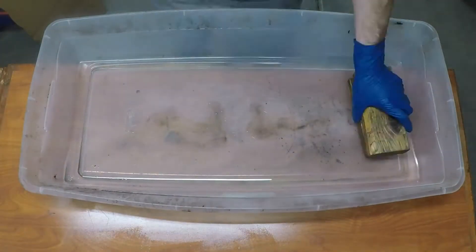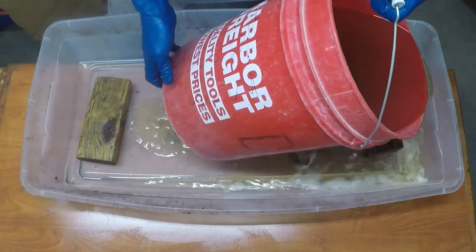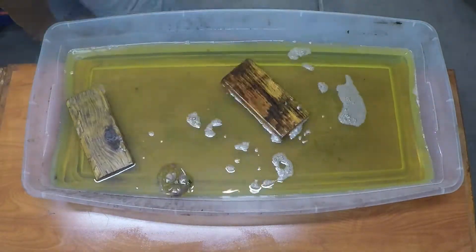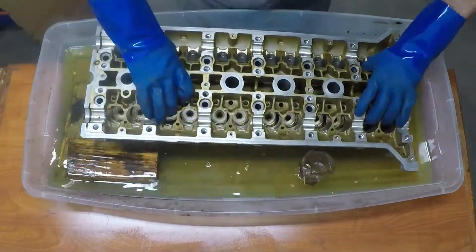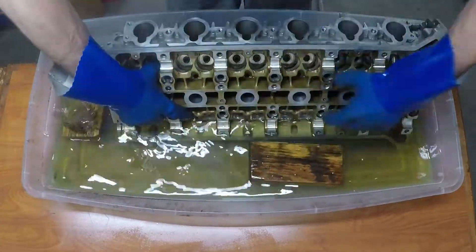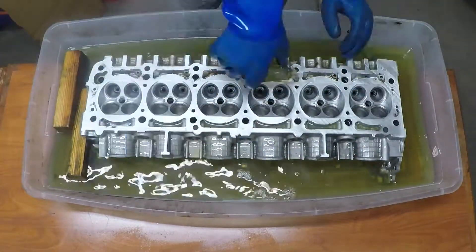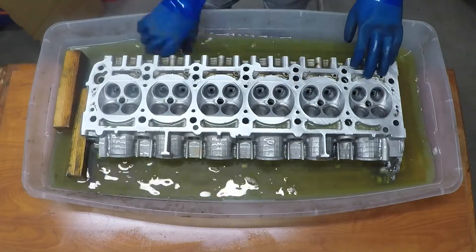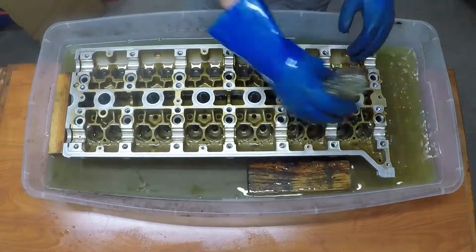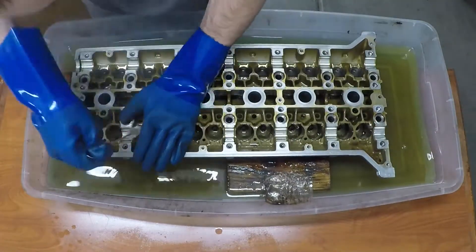This might be a little bit overkill, but I'm willing to go the extra mile for this engine. We want to rinse this with diesel — we want to make sure that there's no aluminum debris that could have fallen down, especially inside of the valve guides. It would be very bad for little chunks of aluminum to be floating around inside the engine. I also, just as a precautionary measure, ran through the valve guides with a plastic bristle brush to make sure there's no aluminum chunks in there, because we're about to do the valves.